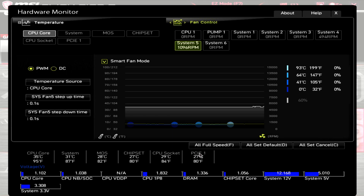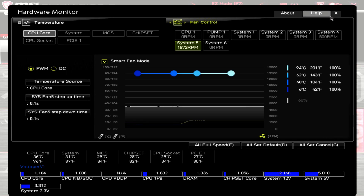With that rant out of the way, before getting into the results of my standardized testing, I want to be very clear: all this testing is based off a sample size of one, so this isn't necessarily the exact performance you'll get, but it should be relatively close. Starting with the PWM range testing — at zero percent PWM this fan has an RPM of around 1100, and at 100% PWM this fan has an RPM of around 1850.